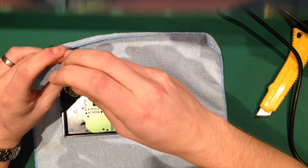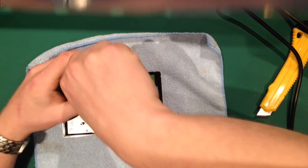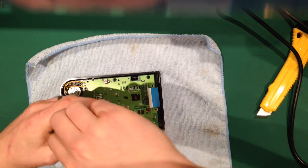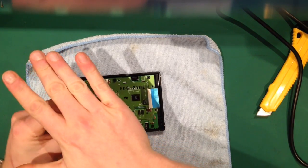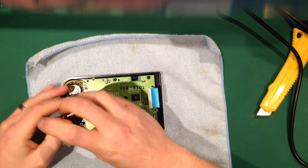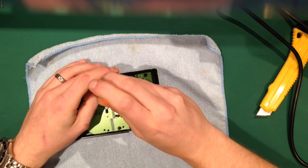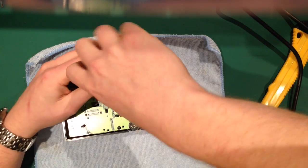It's just because when I first started doing this, I just could not get enough of these screws. I'd take 5 out, and I'd have 5 screws that were completely headless, and I had to throw them away. So yeah, just turning a quarter or that half turn the other way until you feel it click, it makes all the difference putting it back together.